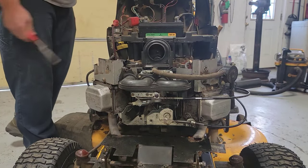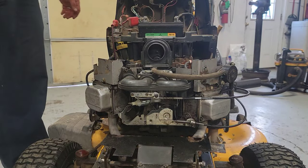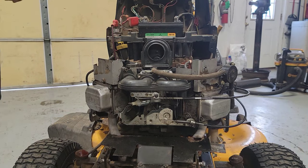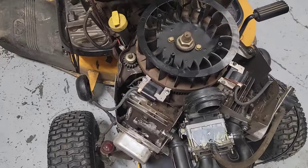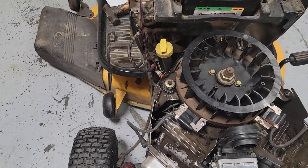We've got an electrical problem with that coil — it's grounding the coil out, so now we're chasing wires. Everything seems to be fine once we pull that kill wire off. So here's the diagnostic process: you just got to start and go through it.